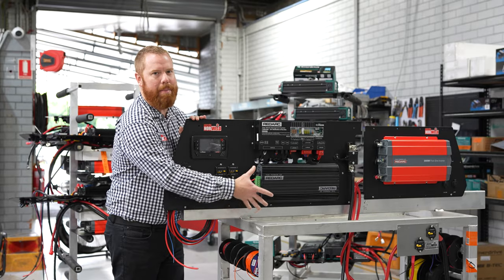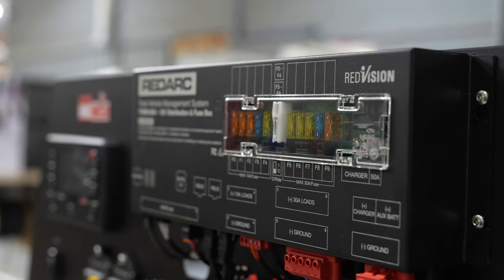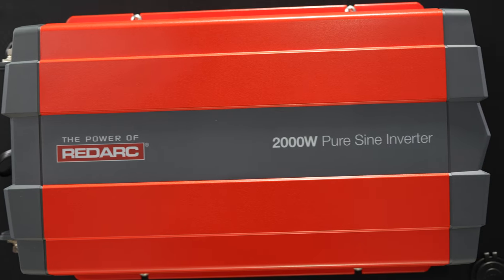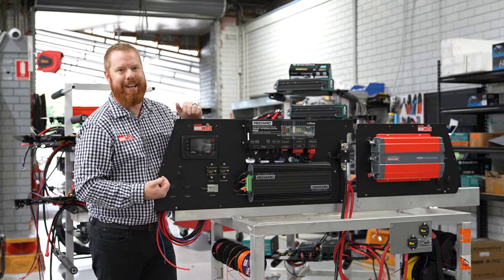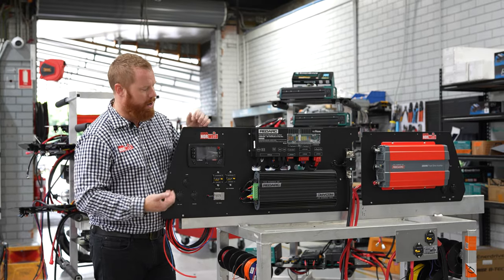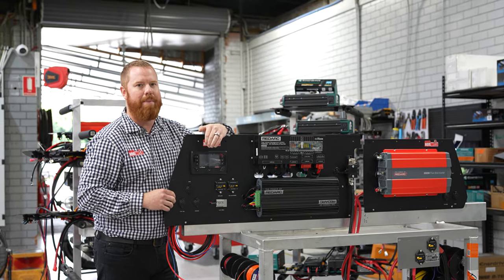As you move back, these are the appliances that do the charging, and this is the switching — the digital or electronic switching — for the lights, inverters, and so on. Through the back we've got our shunts and inverters on the opposite side. The way we lay out our panels, we try to conceal as much of the wiring as possible. That's twofold: it gives a nice clean look, but more importantly it's durable long-term. Exposed wires on the outside of the panels can be damaged as you're putting gear in and out of the canopy, so everything that's not needed is behind the panel.